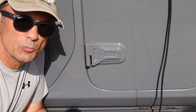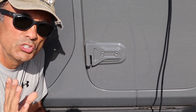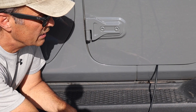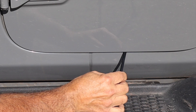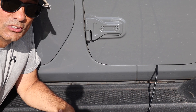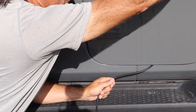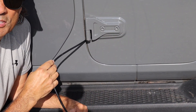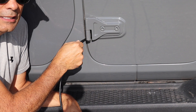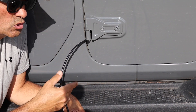When I was camping in Lake Superior Provincial Park, I had the solar panels outside the Jeep and the battery inside, running the cable past the door. A tip: if you run the solar cable through the door and close it, it's going to bind on your cable and eventually ruin it — and that's an expensive solar panel. The tip is: there's a very efficient area right here under the hinge where the cable is not bound in any way. There's some resistance from the rubber seal, which is good, but no binding — so this is a safe area to run any cable into the Jeep.